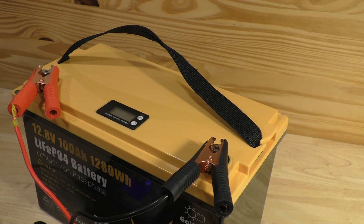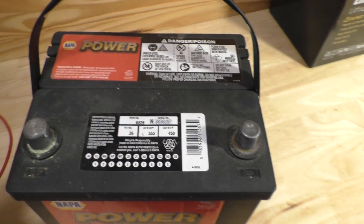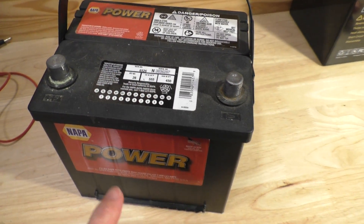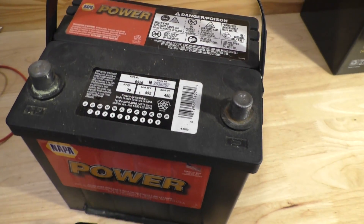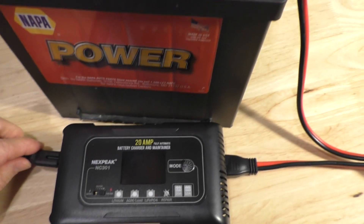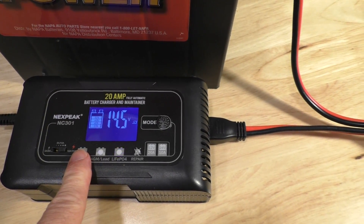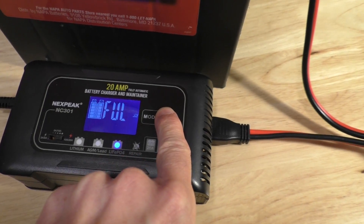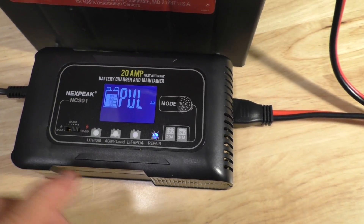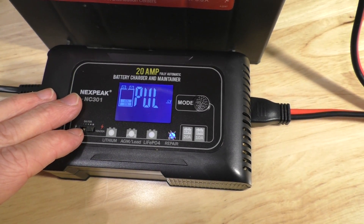Let's go to a lead-acid battery. Next up is this old 12-volt lead-acid battery. This thing was giving me problems — I took it out of a car that wasn't starting well. So this one has some issues. I'm going to try this on the repair mode and see what I get. I got it hooked up. I'm going to switch this to 20 amps since I don't know if it has a lot of charge in it. Plug it in — now it's starting. I have to change the modes. It's doing a pulsing process for the repair. The little manual says it might take about four hours to complete, so we'll come back and see the results.